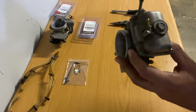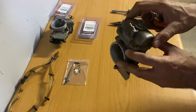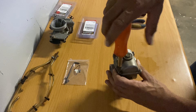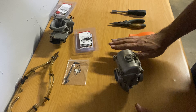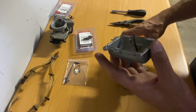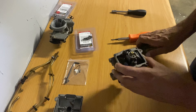This is a pretty simple process. We're going to start off by using the Phillips screwdriver to remove the four screws that hold on the fuel bowl - that's of course after you drain your fuel bowl. Just be careful, these screws are pretty fragile and they strip out pretty easily. You also want to make sure that the surface you're working on is nice and clean - you don't want any debris to get into your carb.